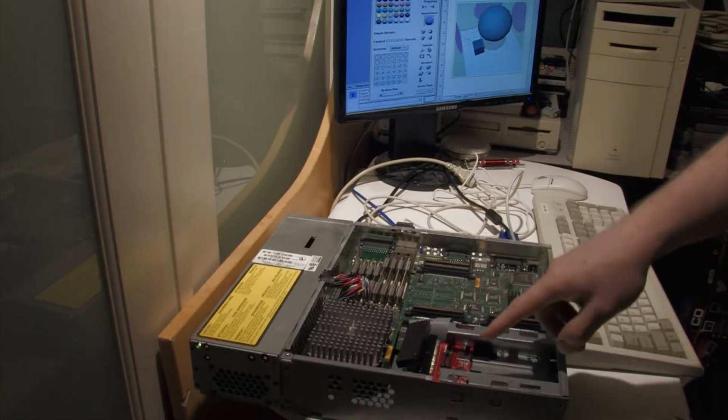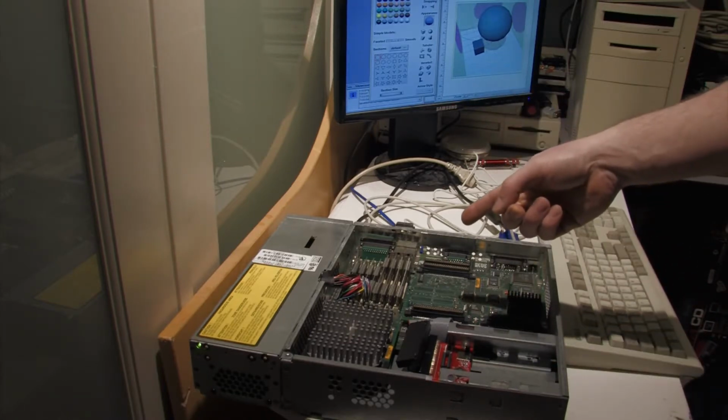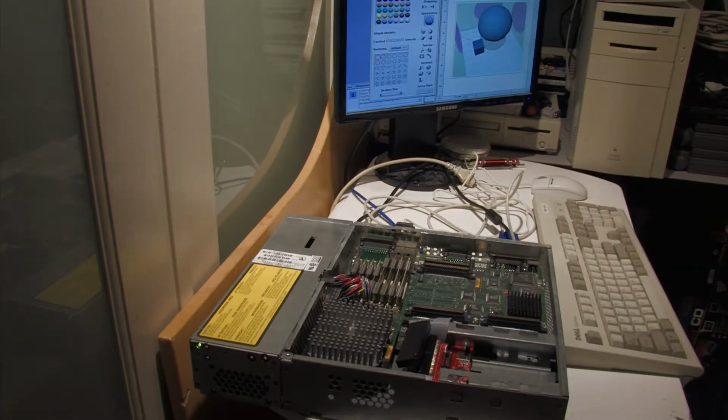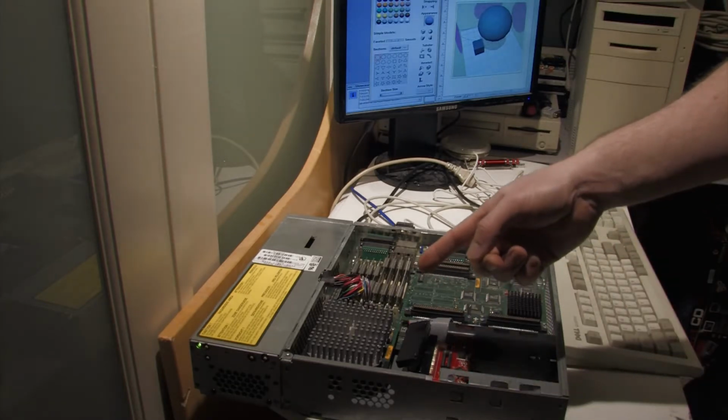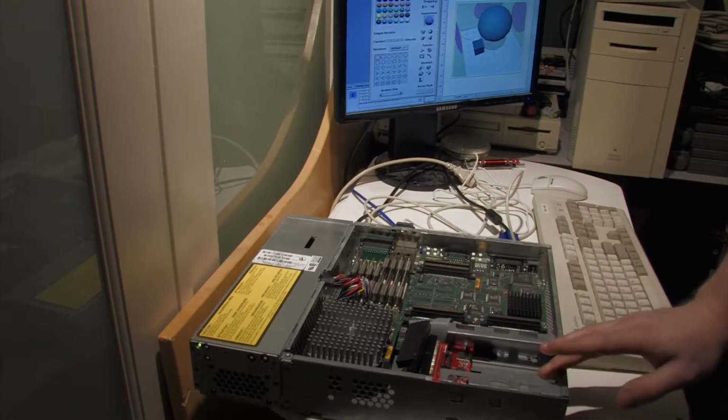It will cover how to set up and deal with the SCSI to SD. I'm just waiting on some more parts. I do have 256 megabytes of RAM showing up, because right now it only has 64 megabytes. It is painfully slow. I also have the original 133 MHz R4600 CPU. I am looking to buy the R5000 CPU.